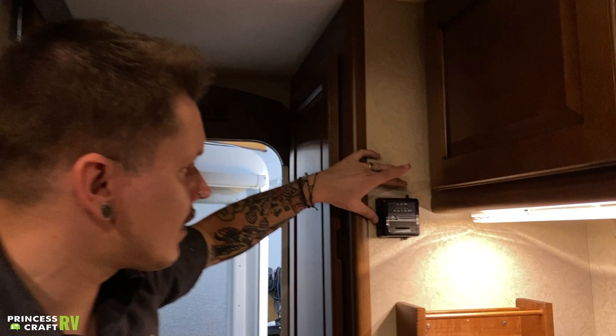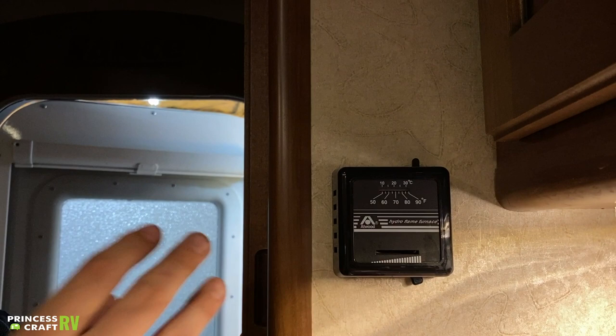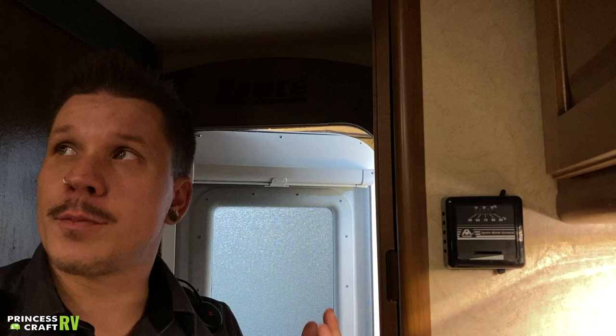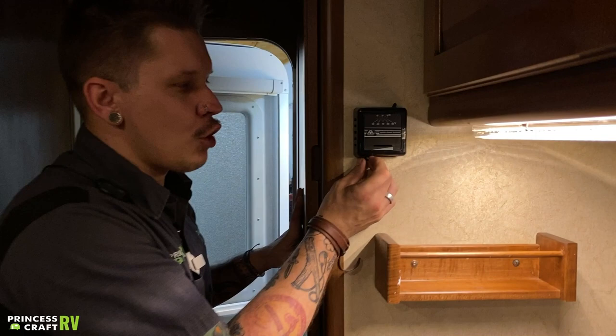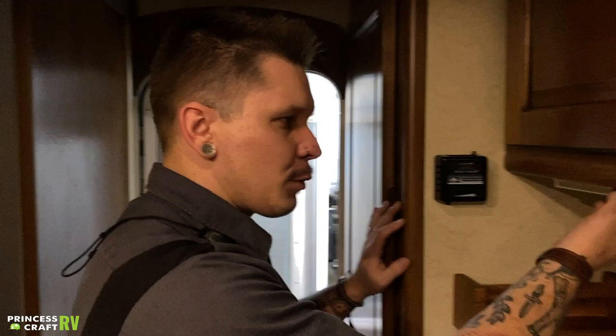Into the kitchen area, we have your thermostat for your furnace. It has a hard on-off switch — pull it to the left to turn it on. That kicks the blower motor on immediately; 16 seconds after that it ignites, and by the 30-second mark it's producing noticeable heat. Generally in a unit of this size, it is going to set off your smoke alarm — the manufacturer states this is absolutely to be expected. The efficiency of the appliance only increases once it runs. The actual thermostat control down low controls your comfort level.